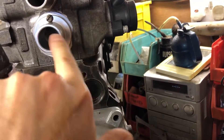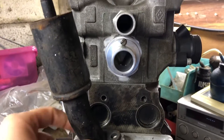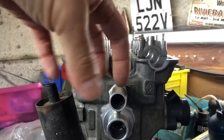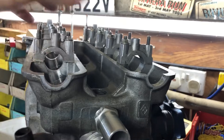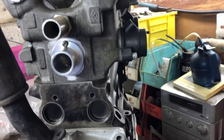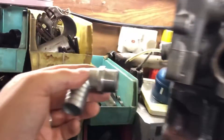I'm still figuring this out — I've got a hose tail to put on here the same size as this, so I could run that straight in and put a filler cap on, because one thing you don't get with this setup — being limited on height — is a filler cap. I'm running the K1200 head which has a magnesium cover, and that doesn't tend to like being welded as much.